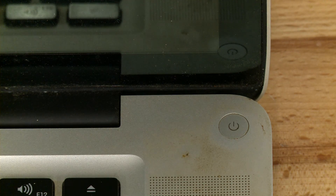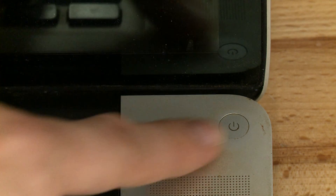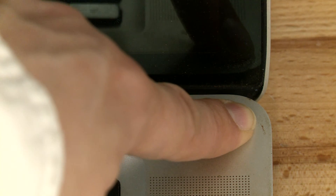When you try to turn it on, it just beeps once every five seconds. This symptom is actually an indicator from the Mac that something is wrong with the RAM. To make the beeping stop, hold the power button for about five seconds.